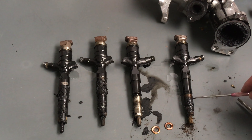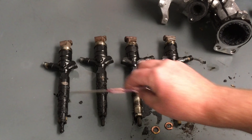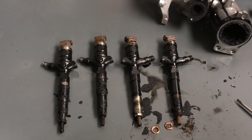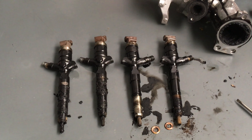There's no O-ring there, guys - it's gone. Where do you reckon it went? Any O-ring at that side? No - that O-ring, she's gone. There won't be an O-ring left in there either. So it cooks the O-ring. This is the only one that's still got one. These three - gone. Those two are long gone, this one's gone. These were leaking ages ago. If you watched the video we put out recently - 149,000 Ks, it's called Dave's Vehicle Inspection or David's Diagnostic - check that out, because that's a perfect example. We got that at the early stage where there was only a tiny bit of leaking at the seats and they were only a little bit stuck in comparison.